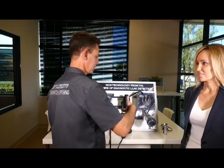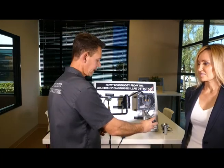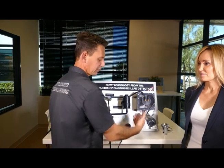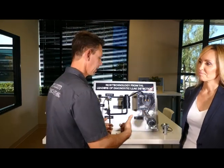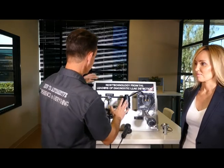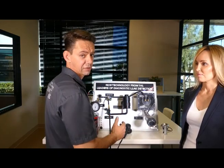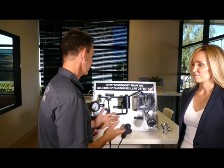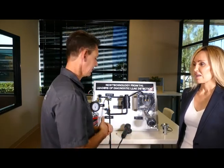If you were to fill up your tank with gas through the filler neck and it was not venting, the pressures would build up and it would shut off your fuel tank so you could only get like 20 cents in at a time. Then at a later time, it purges into the engine so you re-burn the fuel vapor. That's the basics of the EVAP system.